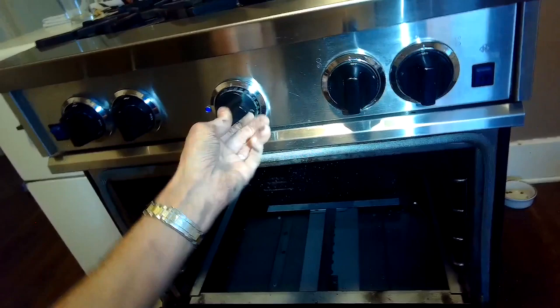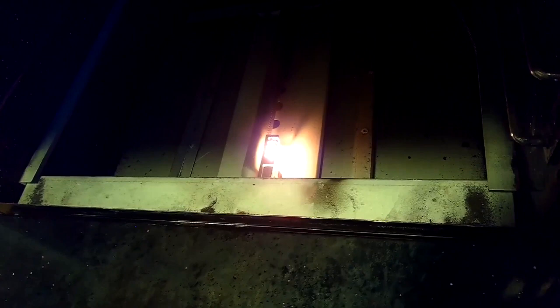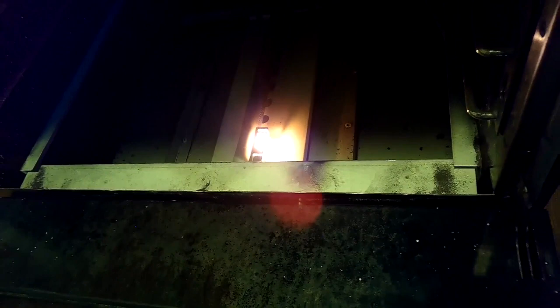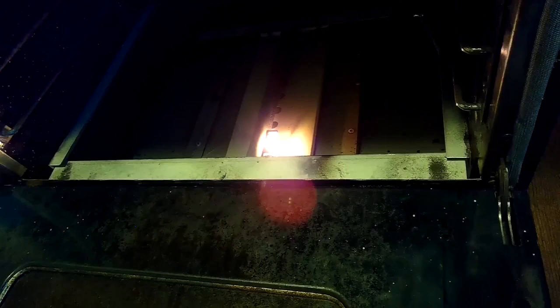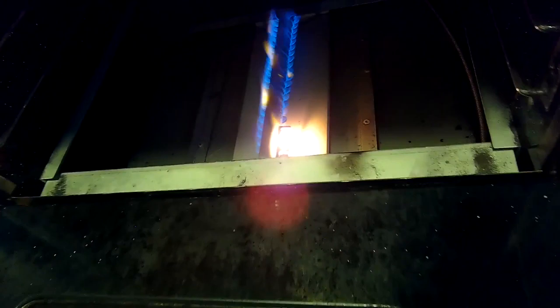We've got those tight, and then I'm going to set the oven for 350 and watch how the igniter does. Turn on the oven, turn off the lights so we can see a little bit better. We see it glowing — we know it has power and it's functioning. When it gets hot enough, the safety valve will let gas flow into the venturi tube and then it'll ignite. Takes usually about 30 seconds. When igniters get old it takes longer and longer, and that's an indication it's time for a new one — sometimes it ignites late and you get a little tiny explosion inside your oven, which you don't want. There we go — nice blue flame; little yellow tinges are okay.